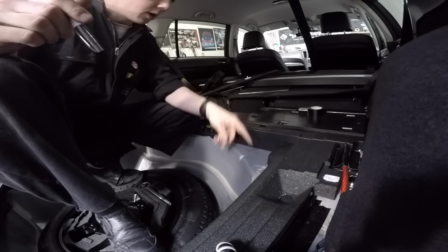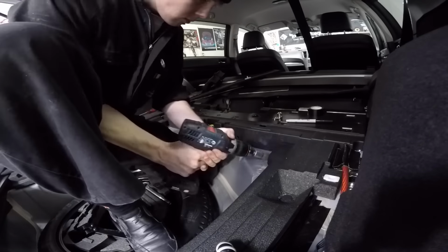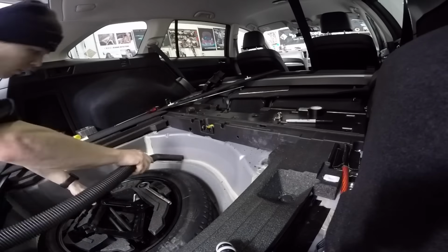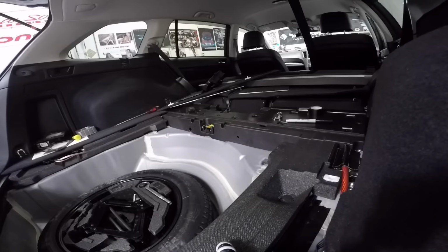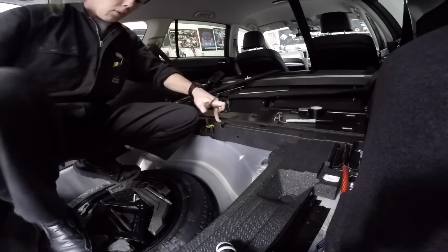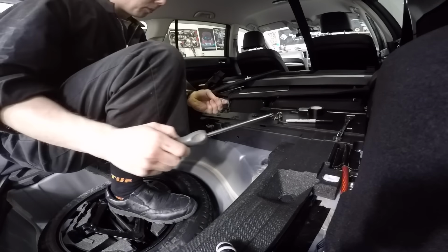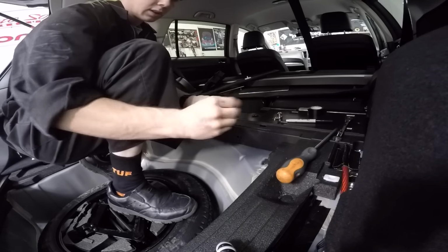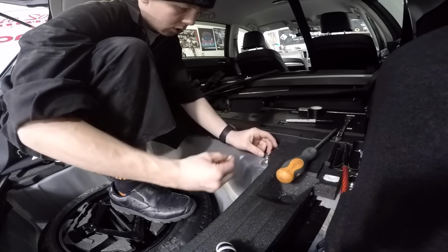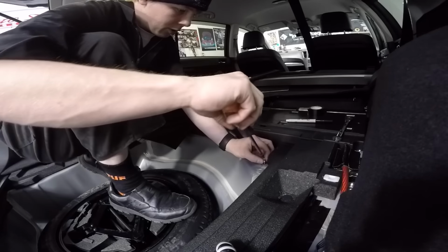Ground foot here so that I know what area I need to brush the paint off. So even though I was able to nut and bolt the ground for the amp, this one I'm not going to be able to because I can't get to the underside of here. So what I'm going to do is use one of these nice big thick self-tapping gold fat screw things. I'm hoping I may be able to get this through the 3mm hole.